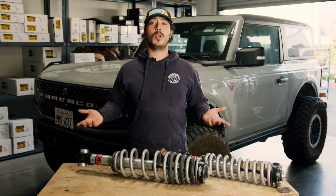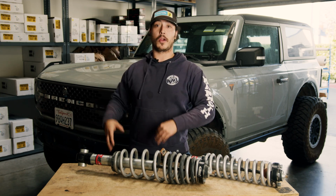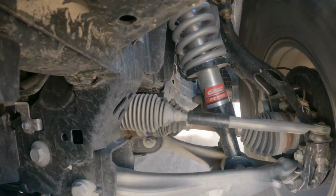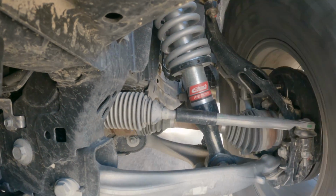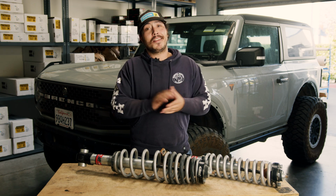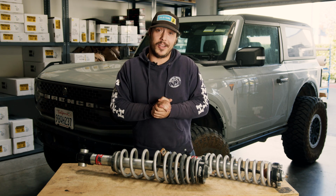Now, tire dribble can simply be defined as the tire bouncing off the road when you're going down the road. And this is usually caused because either the additional unsprung mass or the additional rebound of a stiffer sidewall overcomes the amount of dampening available in the shock. And these Eibachs just really had a problem with it, even on the road. As you might imagine, this is not only uncomfortable, but also feels a little sketchy behind the wheel.